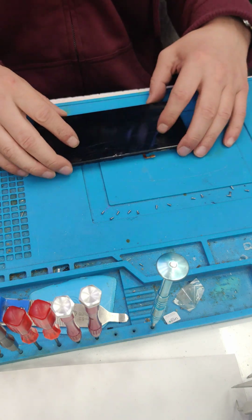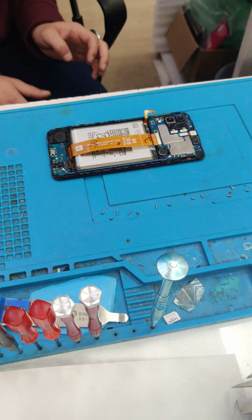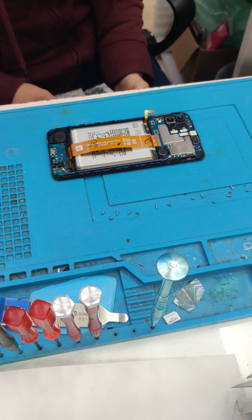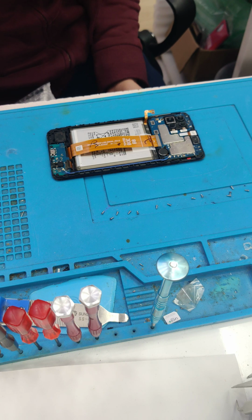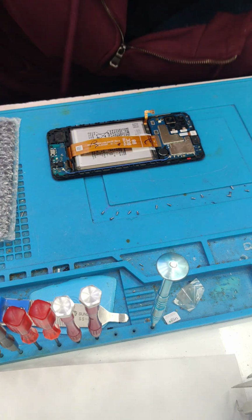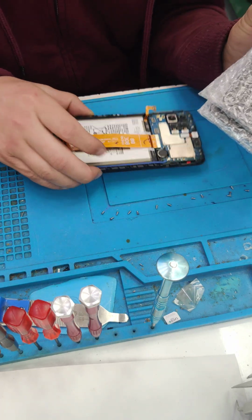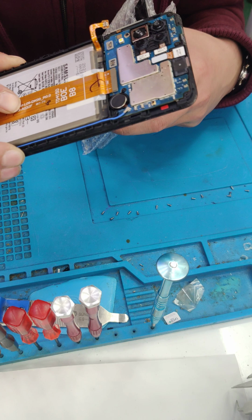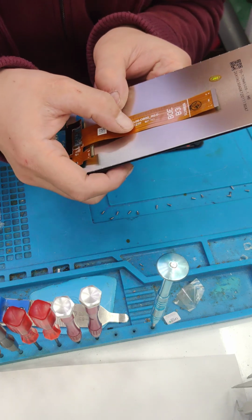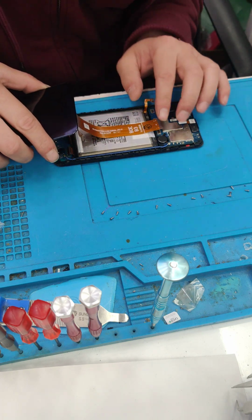No, actually, before I go ahead and take this screen off, I make sure I have either 125 or 127F screen that fits this. It should, no problem. It's just strange having A03 instead of A125 or 127F. We'll try a 127F. There's a 125F screen. They're the actual Galaxy A12 screens. A127F and A125F. So how in the world does this Galaxy A12 have an A03? I don't know. Yeah, SM-A127F. Now, let's make sure this fits.